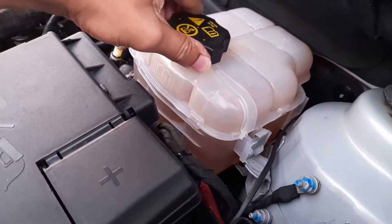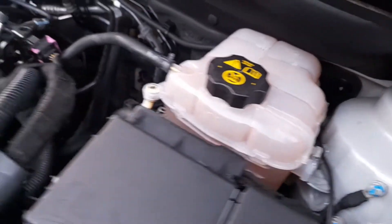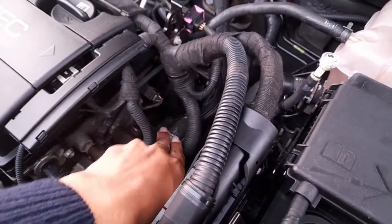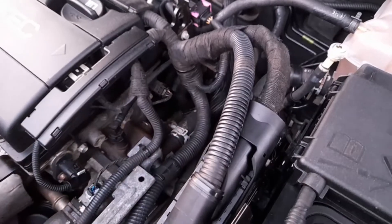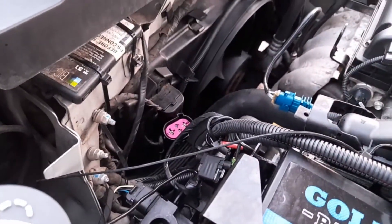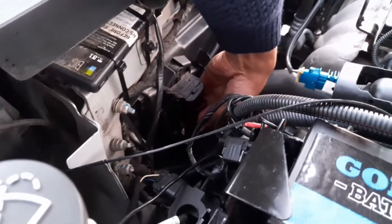The water is okay, no coolant leak anymore. Everything else here is okay. When you remove the sensor the fan slows down, so I don't think there's any issue with the relay. The issue is going to be only the fan switch itself.